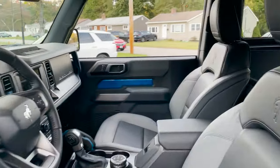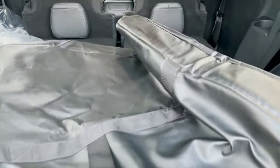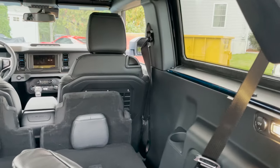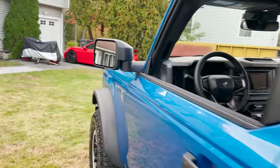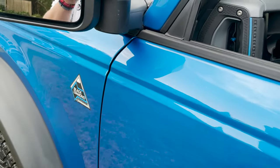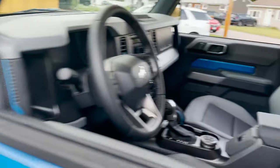Both doors are on — you can see driver's door, passenger's door. And right now, because I don't have car seats or anything in here, I just threw all the bags in the back with seats still down. Difficulty level putting two-door doors on: harder than the four-door doors — straight up — because they're bigger and they're heavier. I actually needed my son on the passenger side to kind of help me set the alignment, and then on the driver's side I was able to work it properly. One additional tip: because of these little triangle caps here, go ahead and pop your mirror to the driving position — that gives you more clearance so that you can angle the door in. And then like I said before, use that pin — do not lose that pin — and you should be fine putting your doors on.